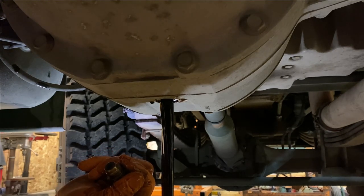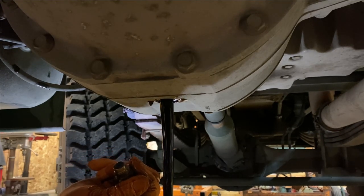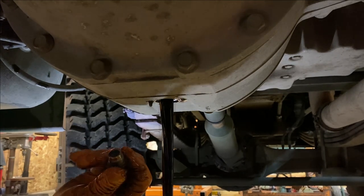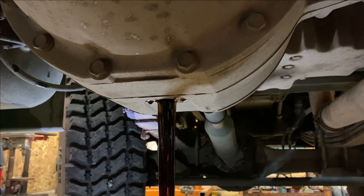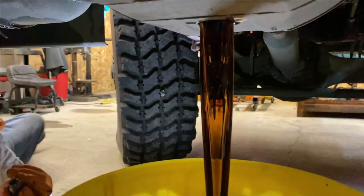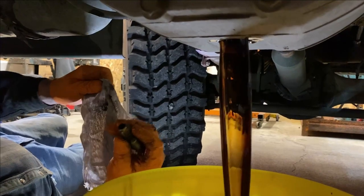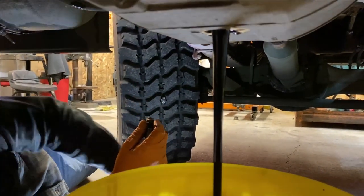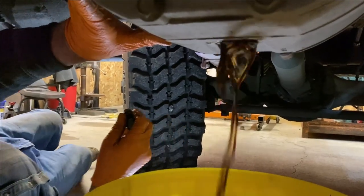It is a little dark, isn't it? Yeah, it looks like used motor oil. Mine looked like new motor oil. Yeah, I think mine's used motor oil. And it is going to come out of there nice and hot. You want to, of course, run the truck for a while so that the transmission is good and hot. Well, there's a magnet right here, and all we got was this little bit of fuzz off of it, so nothing's broken. That is great news.